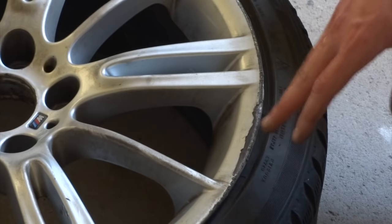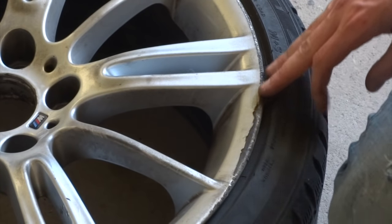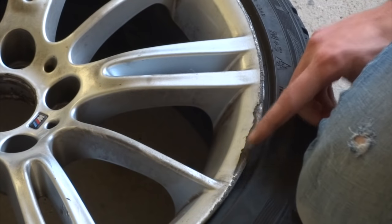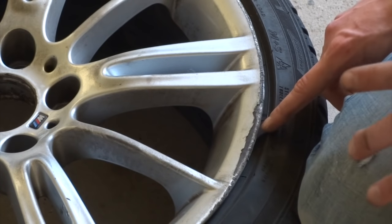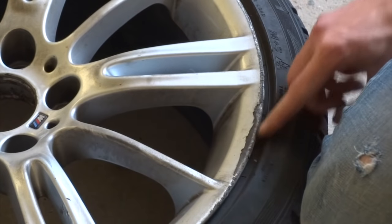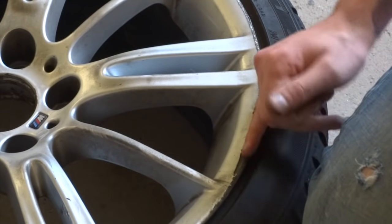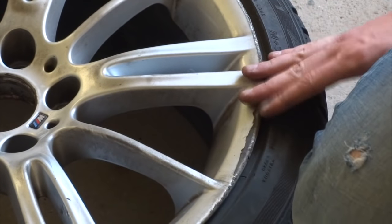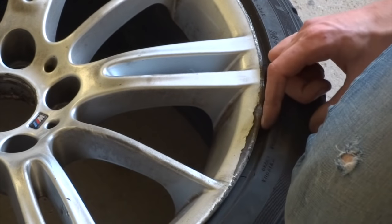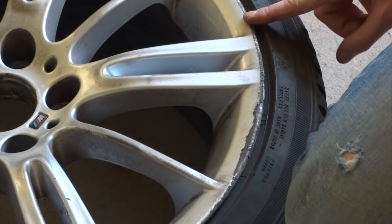Now that I've got it cleaned up enough, you can see around this edge you've got a lot of kerb damage here. I've knocked a kerb, it's starting to peel up, possibly taken off some paint straight away, and from there there's a little dip underneath — dirt's got in, corrosion's going to start building up around there. Basically it's just going to work from the edge inwards. The longer you leave it, the worse it's going to be. Basically, if you nip it in the bud when it's just sort of like this, it's a really easy repair.